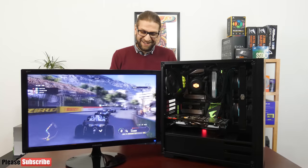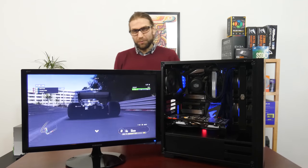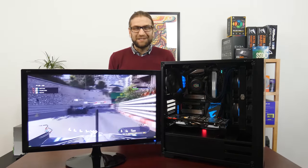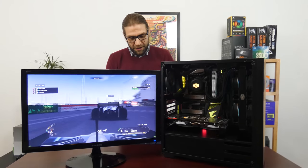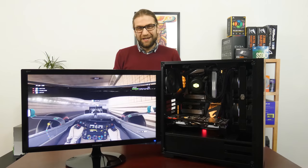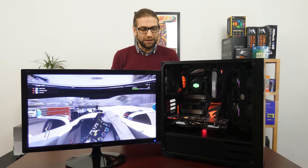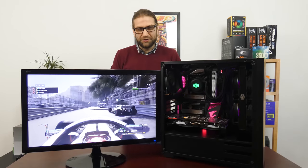So I took that motherboard out, put the other one back in, which is effectively another build in itself. Managed to get that sorted, got it in, it wouldn't post. So I had to take out the Asrock board again, put the Gigabyte one back in. Again, I don't want to go into just how displeasing this was. Managed to get it running with a RAM stick. The video card had to go into the 8X slot because it's not working for whatever reason in the 16X, which tells me that this is definitely something to do with the I/O controller on the processor itself. I fail even to comprehend that two of my motherboards would be completely broken, because they're not. I know they run fine.